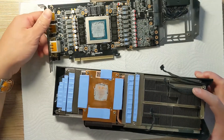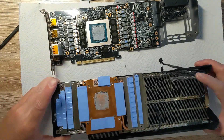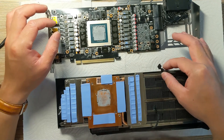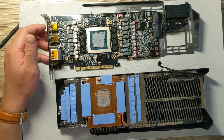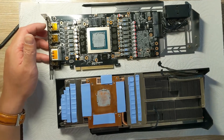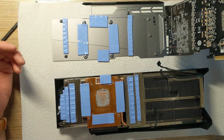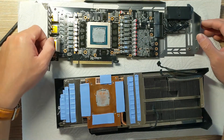When you lift it sideways you're going to see that there are three 4-pin connectors for the fans — there are three fans on the back. You're going to have to turn it sideways and just unplug them lightly and slowly. Once you get it out, you can flip it over and there are three more screws — 1, 2, 3 — you can see the white screw holes in there. Once you unscrew those you can lift this one up too to see the other side. I've re-padded this one before, it's not as good as I want it to be.